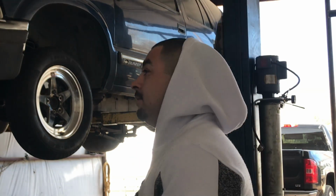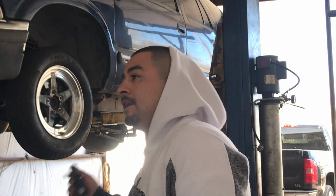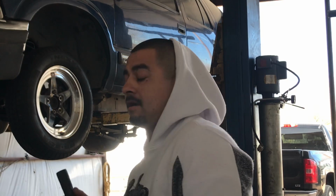Well, the motor actually lasted a long time, you know, without blowing up. But I was having trouble with the transmission. But check it out, another thing, on the transmission, it is a 4L80E, stock. Everything is stock in that thing. The only thing it got is higher energy clutches, deleted wave plates, a couple upgraded mods to turn up the line pressure, and dual feed. And it has a D1 Jake's Performance trans brake. The trans brake would work good all the time. Then I don't know, it started kind of shitting itself. I don't even want to deal with it.